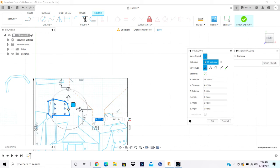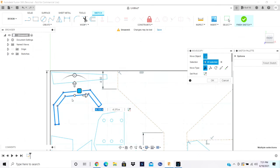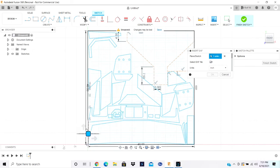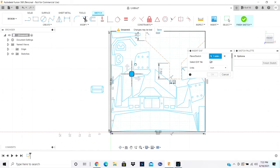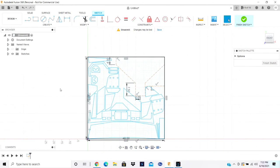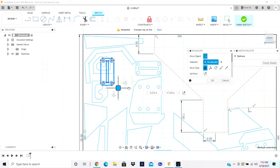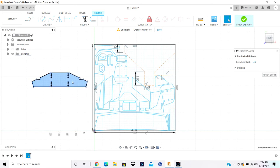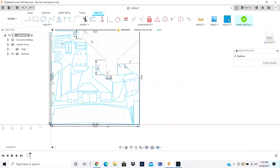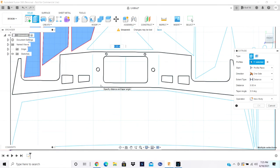We actually used our sheet metal brake for it and it works very, very well. Very pleased with some of the things Madden USA included. There's also a template up there in the upper left — I'm picking it up right there — that you'll see in part two, where we tacked it on to the first panels of the bumper to align all the angles. It's a very nice touch since you're not welding this on the vehicle, and it takes a lot of the guesswork out of making sure it's being built and welded together as designed. The omitted part for this cut was the winch plate, but the whole bumper fits on a 4x4 piece of 3/16.